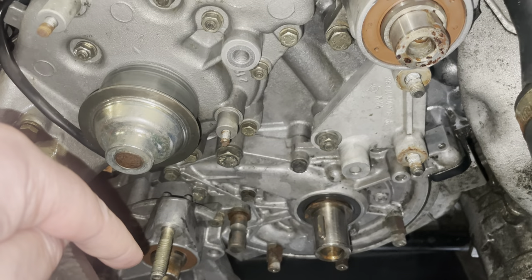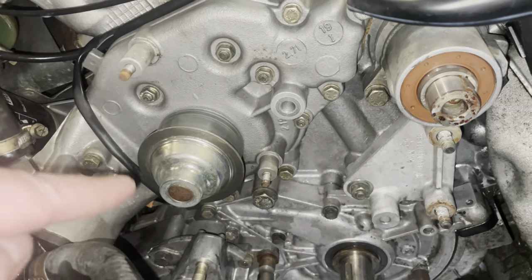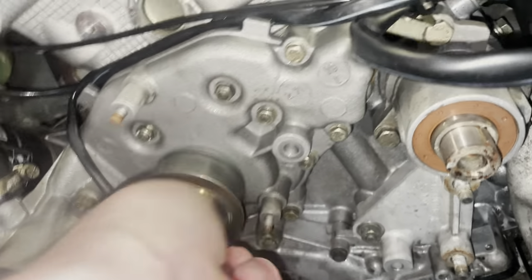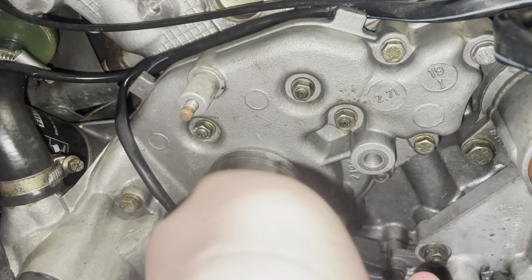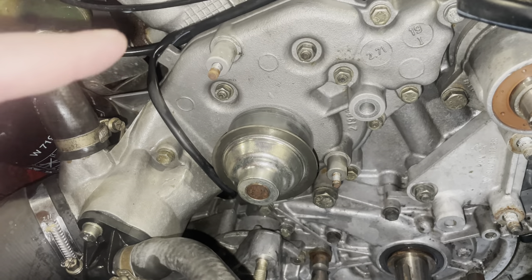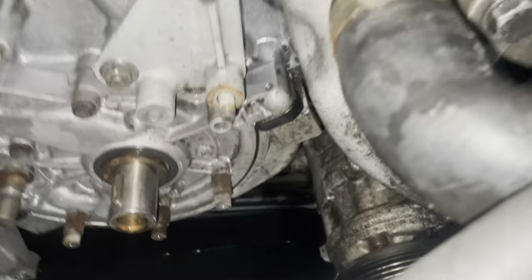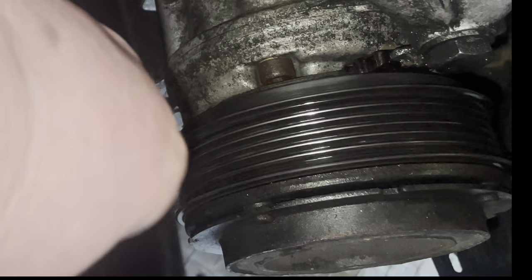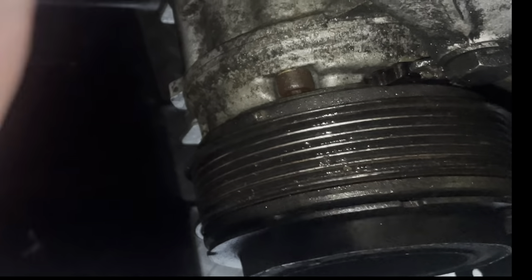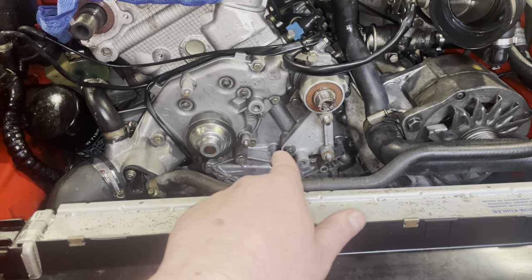A question I've been asking myself for the past few years: will I be replacing this water pump? I don't think I have to - listen to this. This pump is in perfect condition, these bearings are not failing, it's not leaking, it's looking good and sounding good, so this is staying in its spot. However, if I go onto this air conditioning pulley - listen to this - that guy is completely toast. So I'll be looking for a rebuild set for that. For now I'm going to order some parts so I can rebuild the balance shaft seals, and once they arrive we'll start stripping back the engine some more.